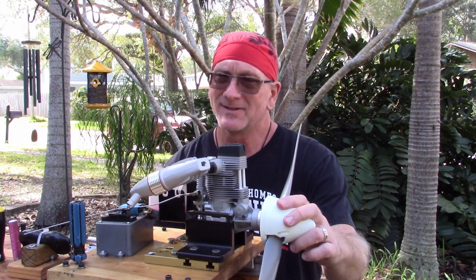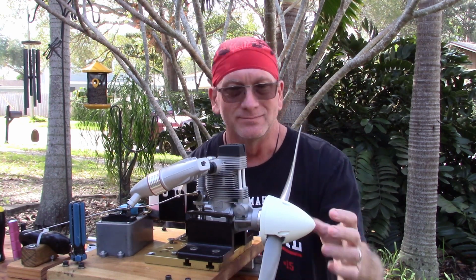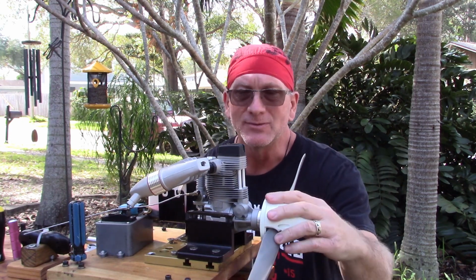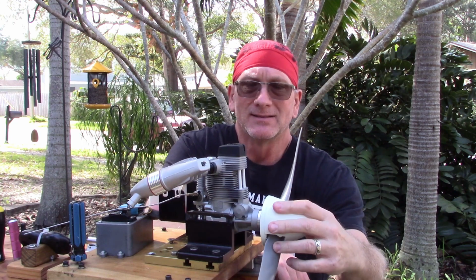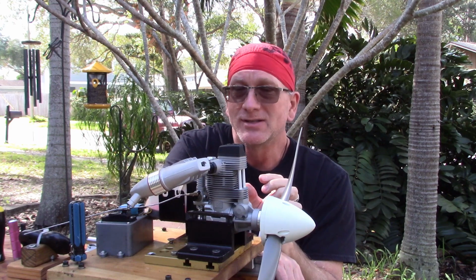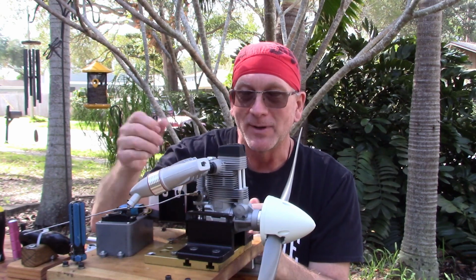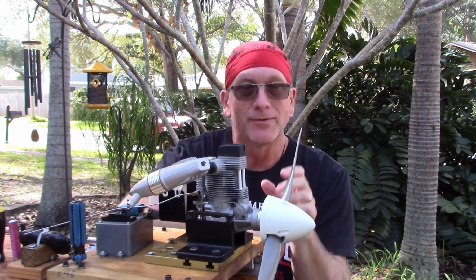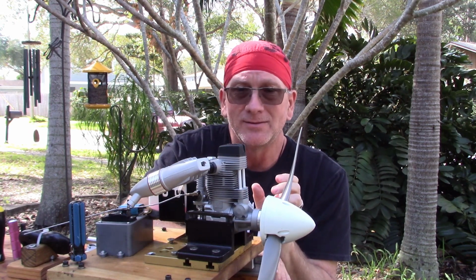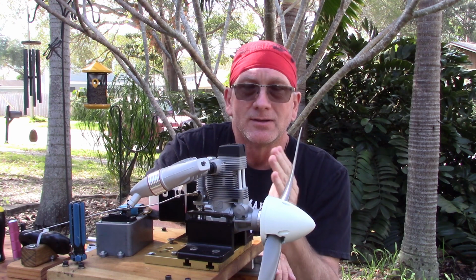Okay, well, I have to say that was a very strange run. That was just a weird run for an engine. I've not had a lot of experience with pumped engines, and quite honestly, I wasn't really impressed with this one. I was trying to do as the OS instruction said, which was, I thought I had it at full throttle, but it was only at half throttle for about the first half of the tank. Then I put it at full throttle, but I was just varying the RPM with the high-speed needle, but it was hard to tell how much to turn it to just move it off RPM slightly.